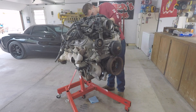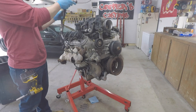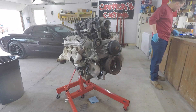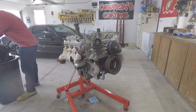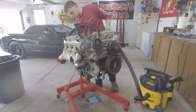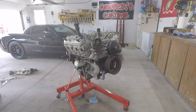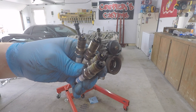After that, we're going to pull off the harness. The harness was cut in a lot of places, so we didn't need those. Some of the spark plug wires were cut, so we're just going to junk those. After that, we are going to pull off the coil packs, and then we're going to move right on to the intake manifold. There were about 10 bolts holding the intake manifold on — those come out, then it just pulls right off the top of the motor. We then vacuumed a bunch of broken glass out. Then we removed the old exhaust manifolds and the spark plugs. There were three broken exhaust bolts on each side, so we're going to have to grip those with pliers and pull those out. The spark plugs really didn't look that bad — you can tell those are relatively new.